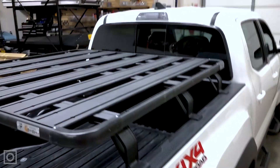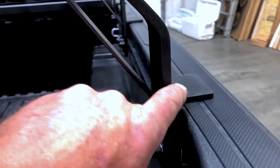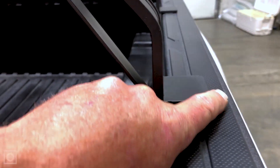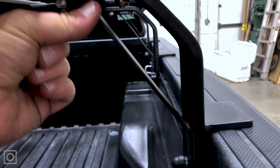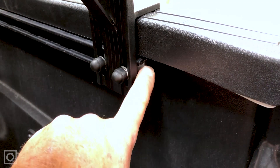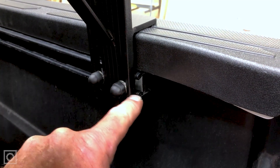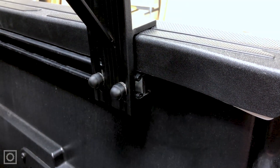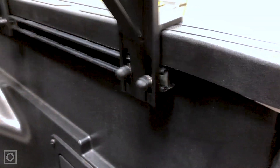We're using a set of very interesting mounts here. This bracket is developed with a backing plate that comes out on the side here, which has more surface area — good for downward force. It has a diagonal reinforcement for downward pressure on the rack system itself, and it ties into our slotted channel on the side of the bed rail. We also have height adjustments, so this might work on other vehicles that have that same type of channel. It's two threaded 8mm bolts going into a threaded plate — it ties on there quite well.